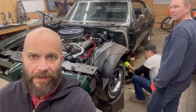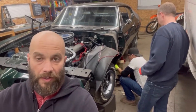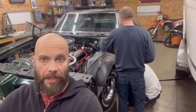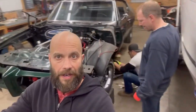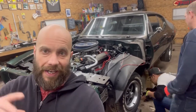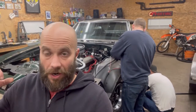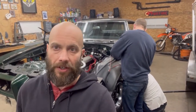As you can see behind us, we went ahead and took the fender off. There's a real tight crease there but what we're doing now is getting the body moved over - it's off by about a quarter inch to half inch on one side. We're going to shift the body over to get these panels lined up, get the doors to open properly, and get the fenders lined up correctly. We went ahead and got everything loose in the front end so it moves around. One thing Eddie found when taking this stuff off: some shims were falling out - these were not factory shims, they were stuff used in an auto body place, and there were quite a few of them. So we know that this car was fixed at one point, but they didn't fix it correctly.